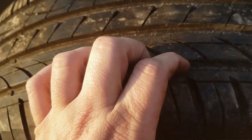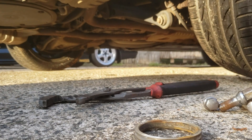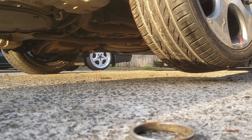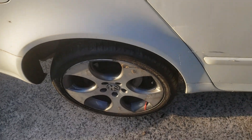The tread is pretty good — see how far my finger goes down there. Inside here looks pretty good too. Brakes are probably good for another 15,000 miles — rear brakes will probably need doing soon, general maintenance for the next person. I'll let them know because I'm not a scumbag. One side down. The offset on these wheels is absolutely horrible — it's got plenty of clearance back there, but it is way in there. Some bad offset, especially compared to the front.